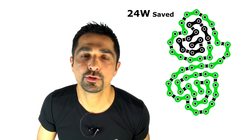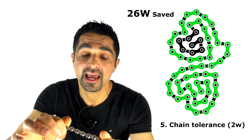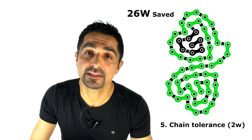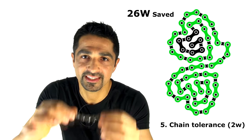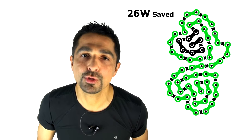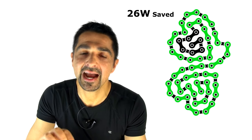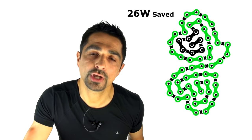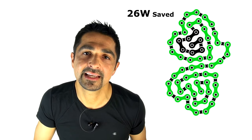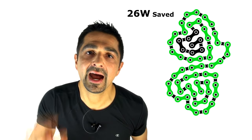Number five, saving about two watts, is chain efficiency. There's a difference even between chains of the same model from the same manufacturer. Bradley Wiggins' sponsors batch tested a huge number of chains for his hour record and found which individual chain performed best. You can't do this at home, but you can buy an 11-speed chain — 11-speed chains are generally made to higher tolerances than 10-speed chains. About a third of 10-speed chains have a high wear indicator straight out of the box, so 11-speed chains are generally made to a higher specification.